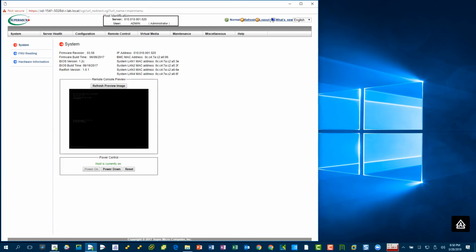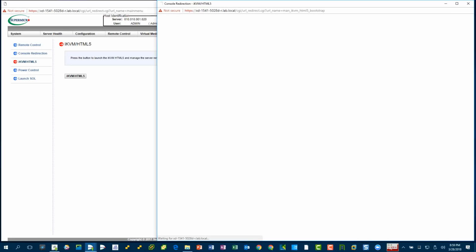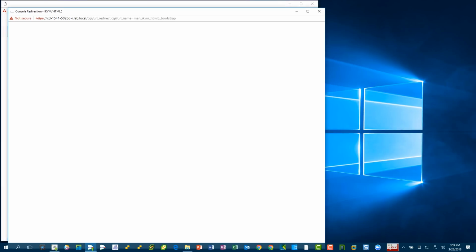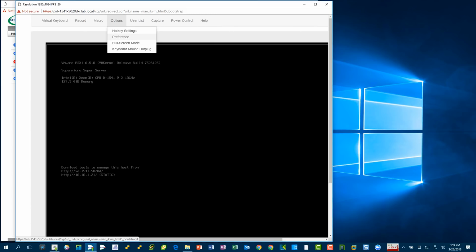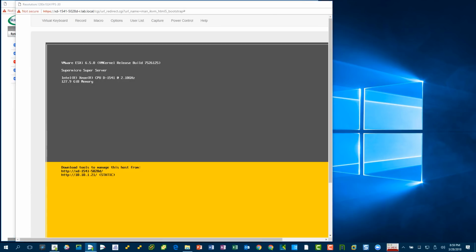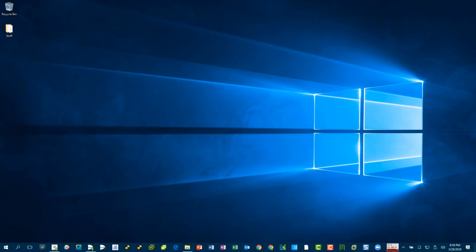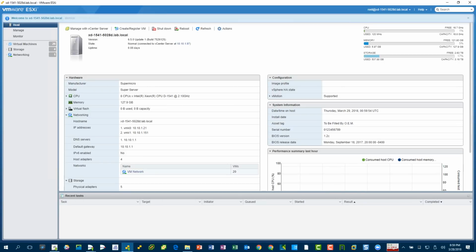Now, I do want to gracefully shut down, and I also want you to see what's going on when I do that. So how about I bring up the remote control HTML5 interface here. And that'll prevent me from going through that Java pop-out stuff. Okay, and then to crank up the quality here of the video, it already is. Good. So yeah, that's just your usual ESXi stuff. Now, I'll also point out with something called vSphere Host Client, that's pointing your browser right to the server. You can also see the BIOS version there if you're running ESXi on your Xeon D system. There it is, 1.2c. It even shows the type of CPU right here.